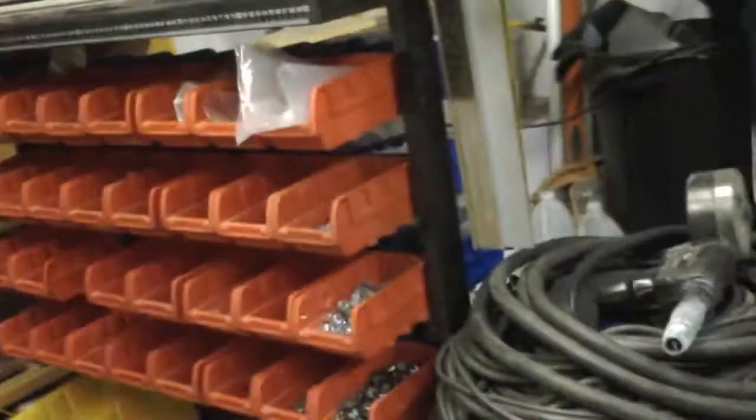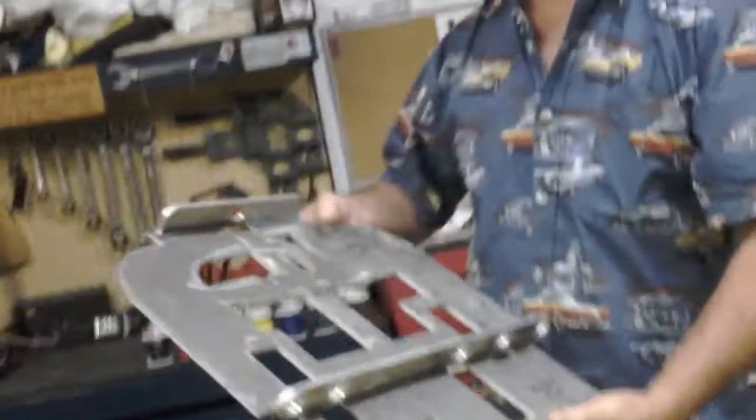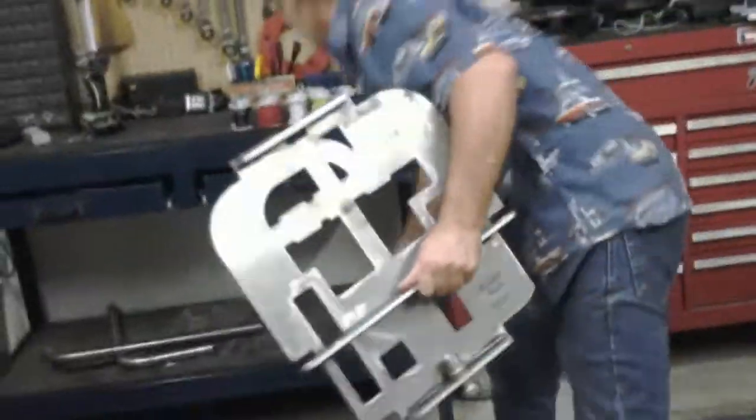We talked a little bit about the tubing that went into this. That's cut on a plain old joint notcher. The notches that were made into this is just a Harbor Freight joint jigger on the drill press over here. But I built this piece right here on the CNC machine. That funny looking deal right there is the jig for building all the A-arms.